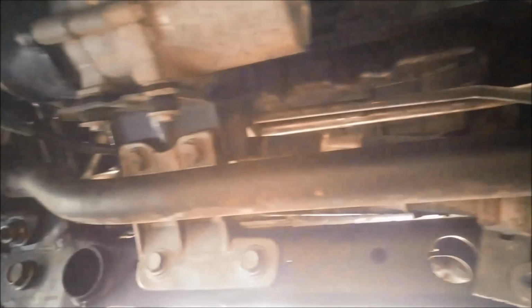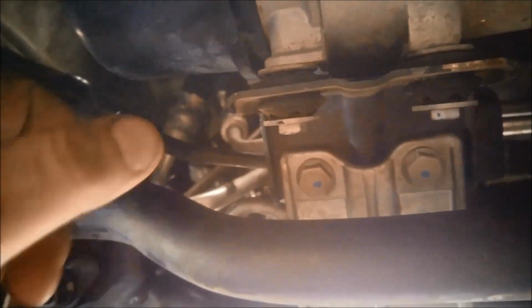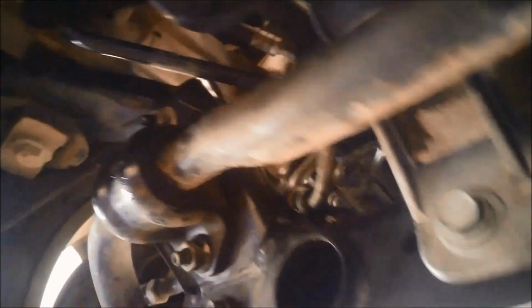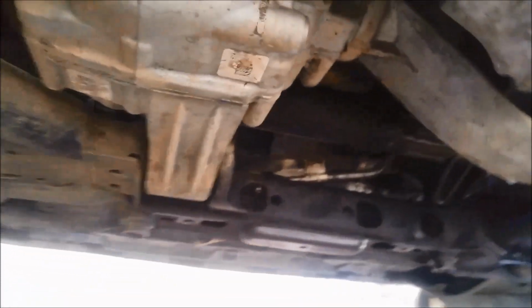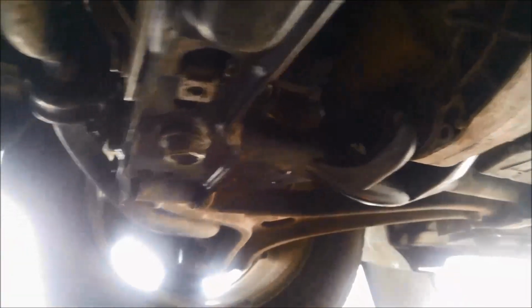If you're ever replacing a rack like that, because of those oil lines there, they are very difficult to get going. Always best to get it going with your fingers first and then tighten it up. So we're just going to wipe off and blow out all this oil and put the brackets all back on, and job's done. Still got to put these stone guards as well back on, give them a wash, especially the one that was right under it and just behind it, all the oil was going on it.